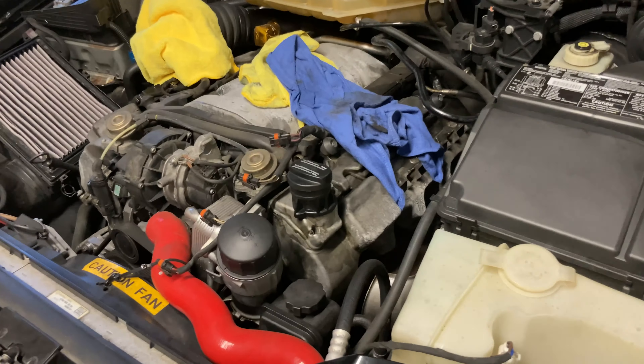On my C55 for example, I thought the valve cover gaskets were bad, but after doing just the breather cover gaskets the motor is completely dry. A lot of times you can get away with resealing the breather covers and getting a lot more life out of it without touching the valve cover gaskets. But in this case it definitely needed to be done. The car needs R&R and love — it's at 160,000 miles and I want to get it to 300-400k if possible, so I want to treat it right.